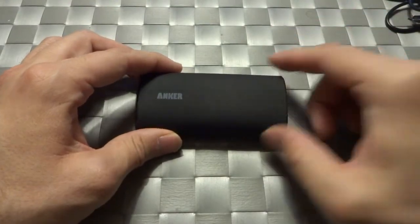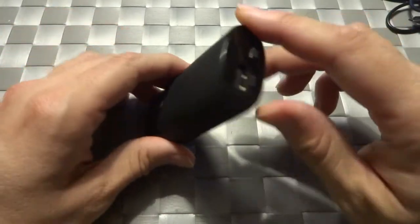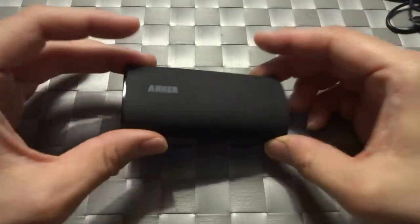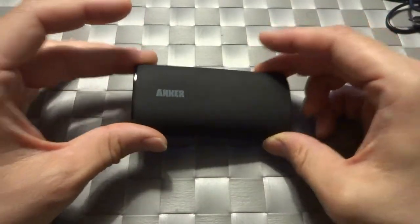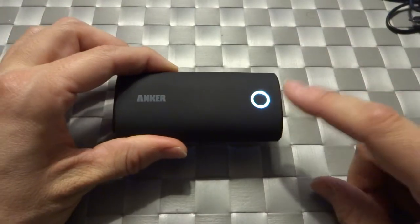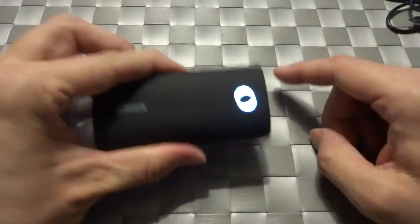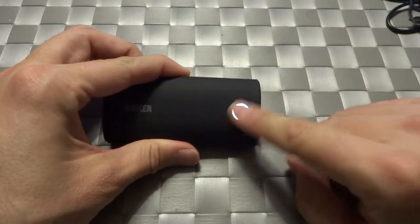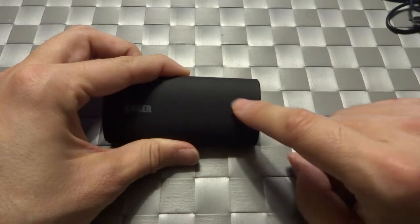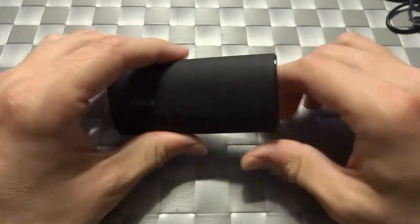As you see, you can see the light turning off and on. That is the user interface. So the big deal about this device is there are no buttons whatsoever. So you don't have to ever turn it on. Essentially, it has some type of motion sensor. Perhaps it's a little mercury switch. I'm not exactly sure, but you just shake the unit, and then the power is output of the USB port. Now, as you can see, I could shake it, and this is a full circle. There are 10 little LEDs in here, showing 100%. As the capacity drops, you lose little segments of the little pie there, which is a pretty good way of working, I have to say.